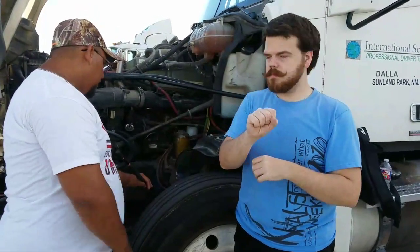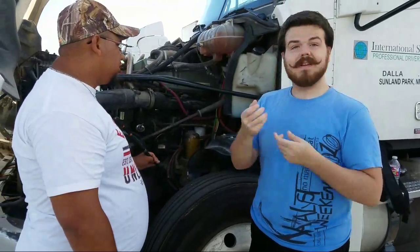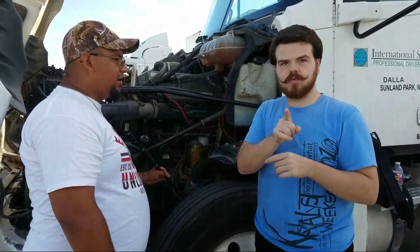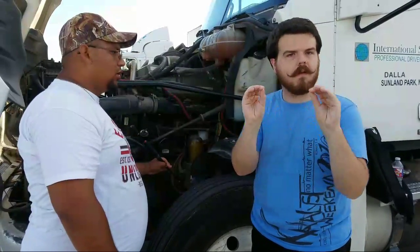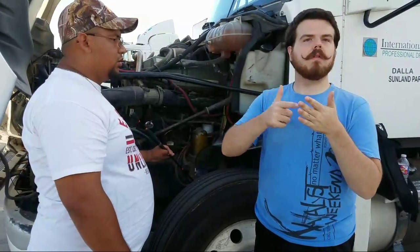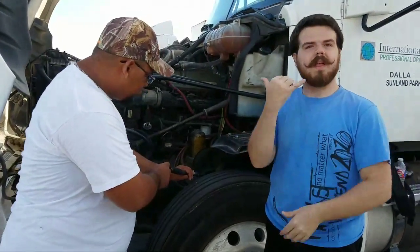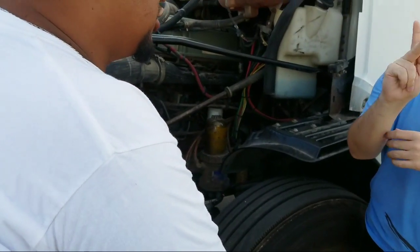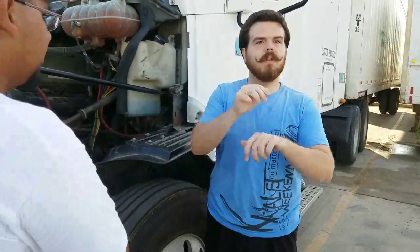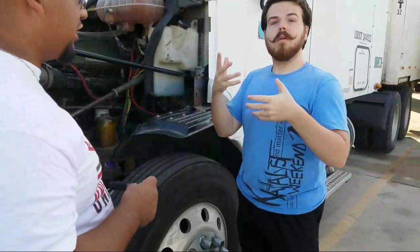Okay? From there, that's connected to the steering axle. Okay? So the steering axle must be checked for not cracked, not bent, not broken, and no illegal welds. Okay? From there we have the shock absorber, which is this yellow one. The shock absorber must be properly mounted and should not have any leaks. That concludes our suspension system.